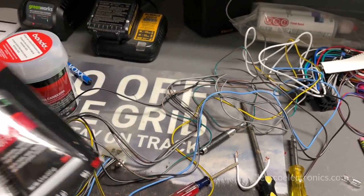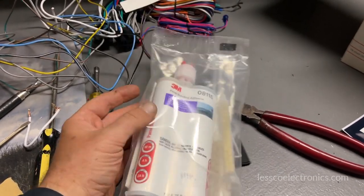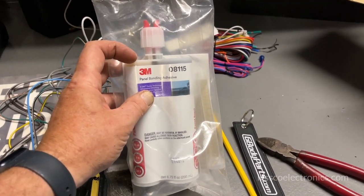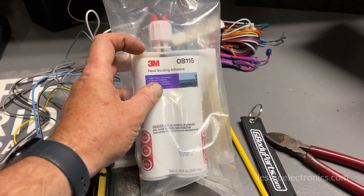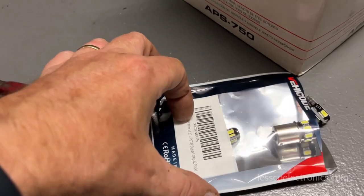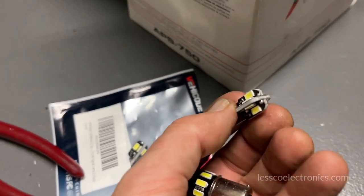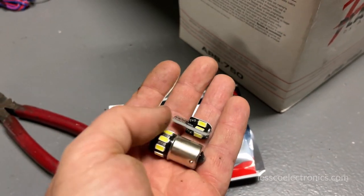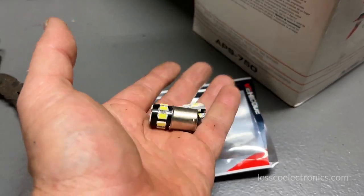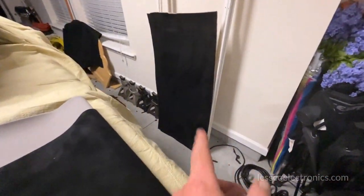Glazing putty for the top to make it all perfect, and anything else I find in the interior panels. I'm going to do a no-weld floor pan installation — cut it out, grind metal to metal, and use this 3M panel bond product. You put it on there and get a tremendous result. All the LEDs for the interior: I ripped out the old stuff and got new hyper white LEDs — a tremendous difference especially on the instrument cluster, super cheap on eBay. Over here I've already done my headliner — beautiful suede, a super nice upgrade.